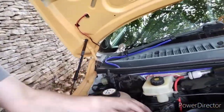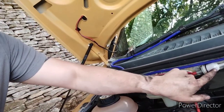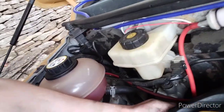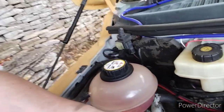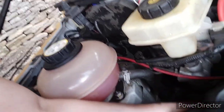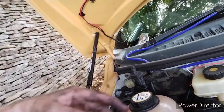I've also done the turbo vent feed, and I've relocated it up here so it's easier to see. I'm going to replace this connector because it's a cheap, horrible thing. But this one, if you just follow it down with your hand, it sort of reaches down the back of the engine and curves 90 degrees right at the bottom, underneath here. I've put in 4mm red silicone again, and there's three clips as you go down through here - one onto the back of the metal arm, and then two on the back of the engine as you go down.